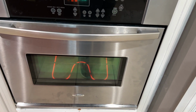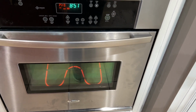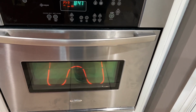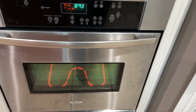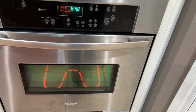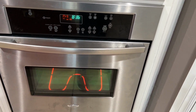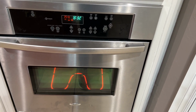You wanna make sure when you push that temperature element back up inside there, that it's clear and it's screwed in where it should be. You don't want it to be off. You don't want any of those contacts hitting any metal. There should be some insulation back there. That's fine. But I'm gonna let this go and let it heat up completely and see what we get.